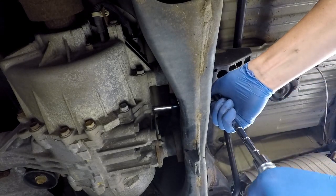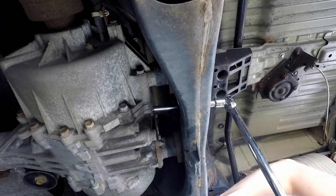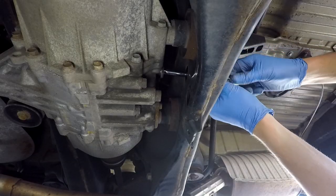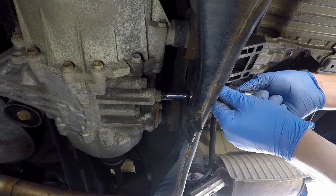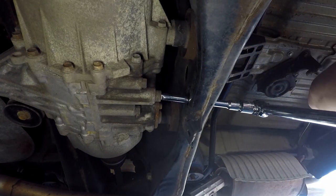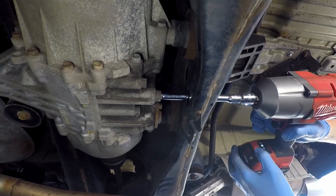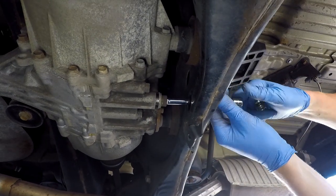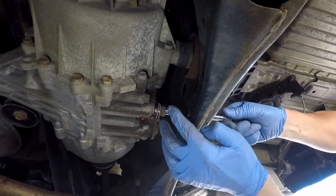Using the 3/8 extension on a ratchet, I quickly realized that I do not have enough leverage to do the job. So I switch to a longer breaker bar and crack the fill bolt loose. Then I unscrew the fill bolt completely out by hand and set it aside. After that, I move on to the drain bolt on the bottom and instead of struggling with the breaker bar, I switch to an impact wrench to break it loose. These bolts can be quite stuck, so I switch to the third power level and the bolt finally comes out. I unscrew the drain bolt till it is completely off the threads, but I do not take it out completely to let the fluid drain out without making too much mess.